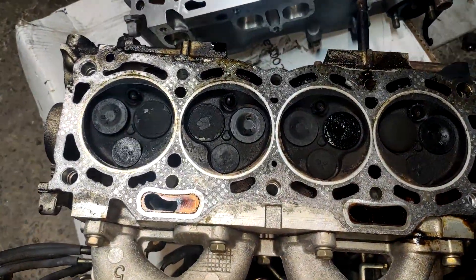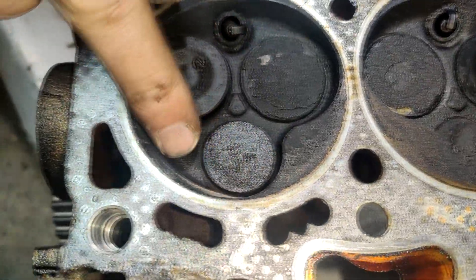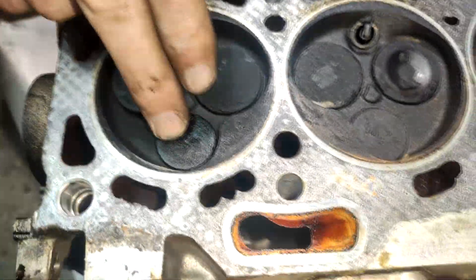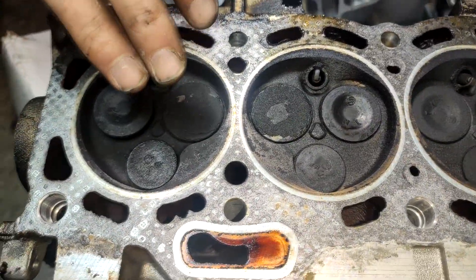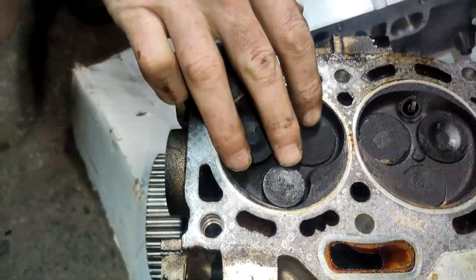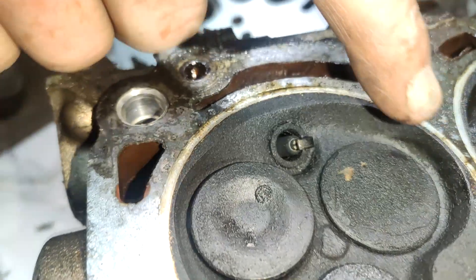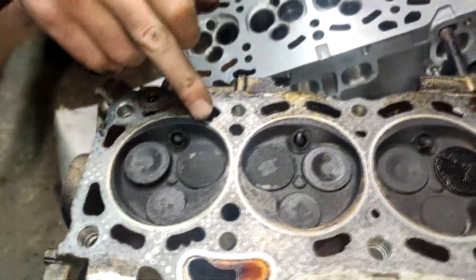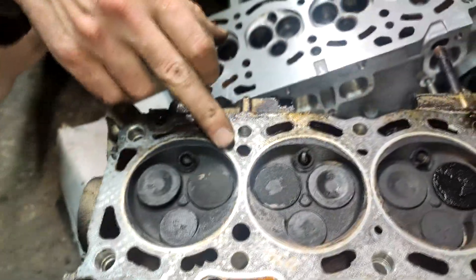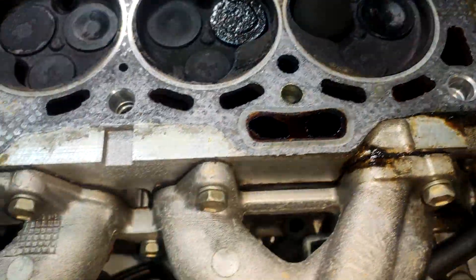Back here with the Toyota 3E guys. As you can see, this is a 3E head - all 3E heads are all recessed, that's 21mm. So that's a 21mm valve, and on the 2E it's only 15mm. So you're already getting a massive increase in flow just from that valve being a little bit bigger. Compared to the 2E you do lose a lot of compression because all this is being cut out. It's a 9.3 to 1 compression ratio in a 3E, and a 2E is a 9.5 to 1 compression ratio. So it's not too much but it does do a bit. I just skim the head down a lot and put a head gasket on and that should bump the compression up.